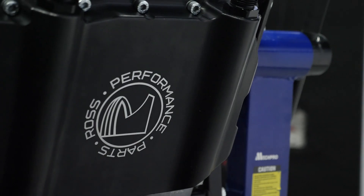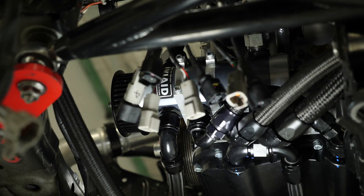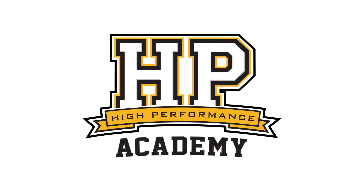One of the modifications we'll quite often see on race cars is the move to a dry sump lubrication system. In stock form the sump is referred to as a wet sump, and basically all of the oil to lubricate the engine is contained in the sump at the bottom of the engine. There's a simple oil pickup that goes down into the sump, there's a built-in pump normally driven off the crankshaft, and this draws the oil out of the sump and forces it through all of the oil galleries on the engine. That lubricating oil is an essential part if you want to keep your engine intact. This works really well for a road-going car and it's cheap to manufacture, which is why OE cars generally use wet sump lubrication.